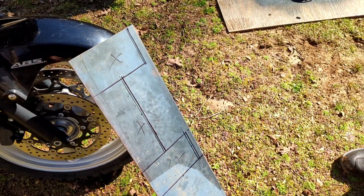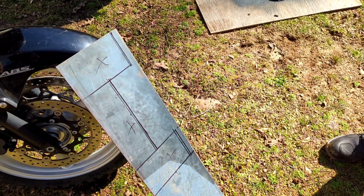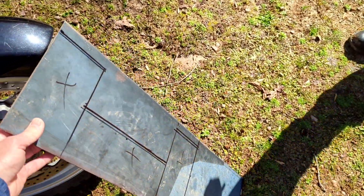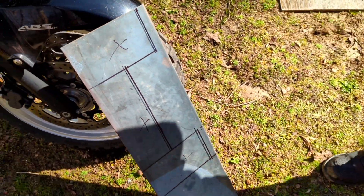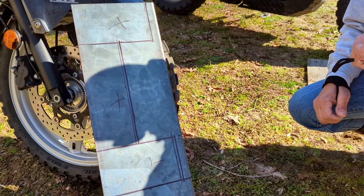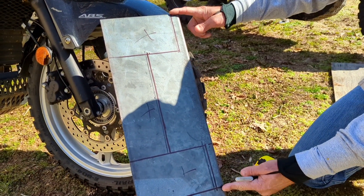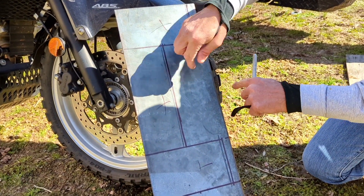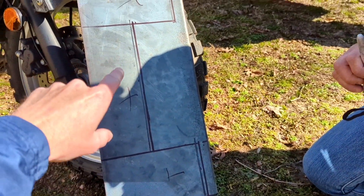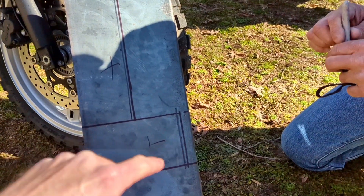There's the piece of steel we're going to use — it's about 14-gauge steel, don't quote us on that exactly, but you can see about how thick it is. You need something pretty heavy duty so your lights don't bounce going down the road. From the long measurement, from there to there is 19 and three-quarter inches, and from the inside right there is four and three-quarters. So all we're going to do is cut this out and put two holes in here, and your lights will be mounted on either end.